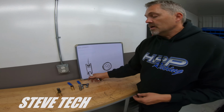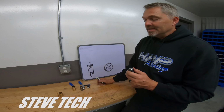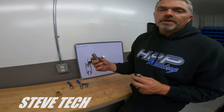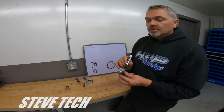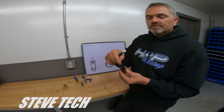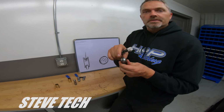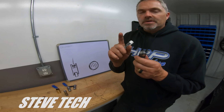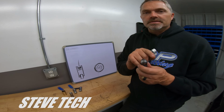Now let's also talk just real quickly about the lifter wheel size. The common Chevrolet lifter size is going to be 842. The common Ford size is 875. That's stock from the factory. As we continue to go to bigger diameter lifters, the reason for the bigger diameter is, I could care less about this diameter. That really is not the deal. What the deal is, we're trying to get a bigger wheel. Now I'll talk to you about why the lifter likes this bigger wheel first. We'll talk about why the camshaft likes it later.